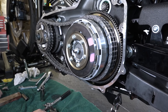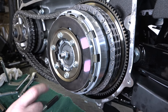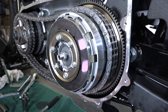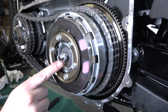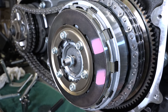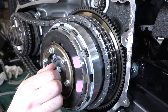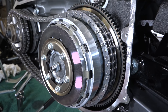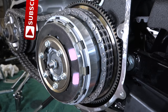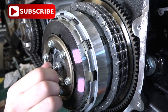To properly adjust a Harley clutch internally at the clutch basket is a pretty simple process. Right there is a threaded adjuster bolt — a 7/32 inch Allen wrench is how you can tighten and loosen that. Most of it can be done with your fingers, and then there's the actual lock nut which just locks it in place. Now we're going to turn the actual bolt in until you feel a little bit of resistance. That's your clutch engaging — the point of engagement. First back it out a little bit so it's nice and loose, then turn it in just until you feel pressure. You'll feel the clutch start to seat.